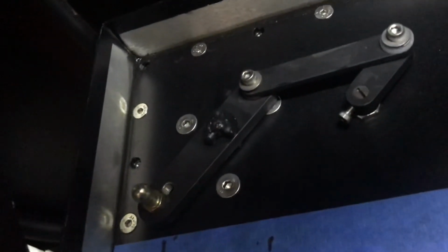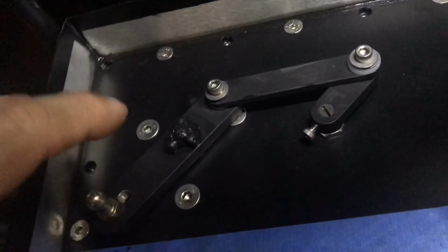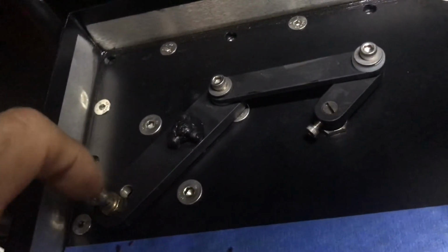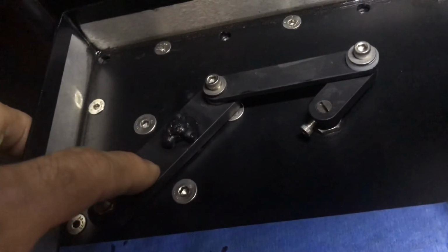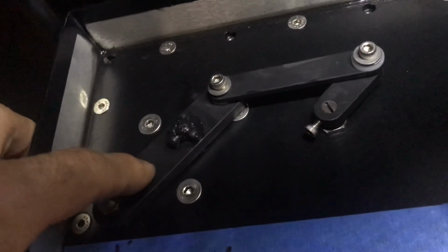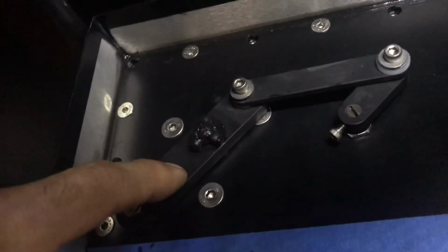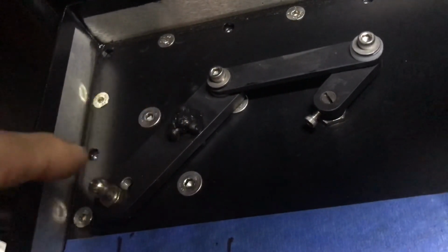So now I'll kind of give you some of that weld that's right there. That's your pivot point, and that's where it's mounted to that servo. There's a giant servo in there. If you guys hook the cable up first, I've been told this by a guy that has done a few of these in California, if you hook that up and this detent is wrong, it will literally snap this arm right off. And then you're in a world of hurt because you can't order this stuff anymore because obviously MasterShift is not around. And trying to re-weld this aluminum and transferring heat into here, you may run into some other issues.